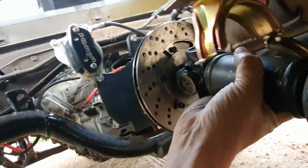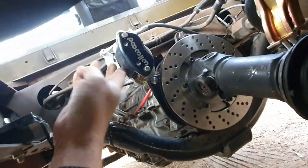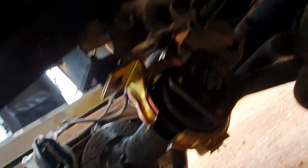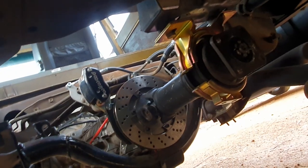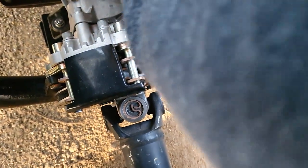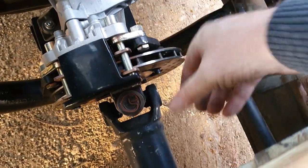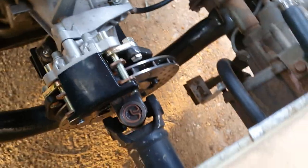It's quite neat just having one bolt here — you can lift that up off the rotor. Put that back in place. Built up the shaft again, put the caliper back down. Take two. Go back together. I didn't change the adjustment since I last used it — it only moves five mil, but I can turn this by hand. They are rubbing as they should, but it's not a heavy force. It should be fine.